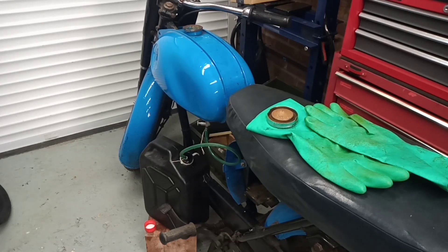When I was looking at the carburettor and had the little plastic fuel filter in my hand, there were definitely rust flakes in there. We've got to stop that from happening if we want to get any reliability out of this bike. I'm going to have to do the same job with this tank that I did with the little Garelli bike a few weeks ago. I may not have to put the sealer in, but I'm definitely going to have to get the rust out, so I've drained out the fuel.